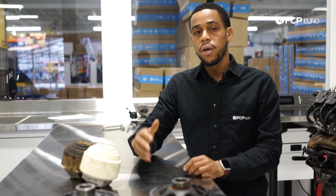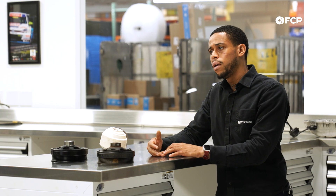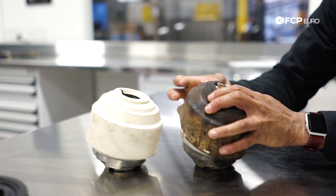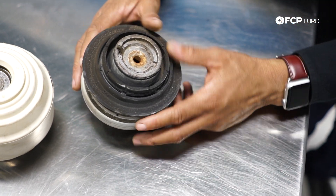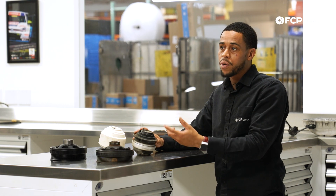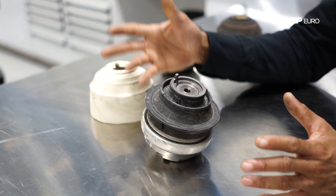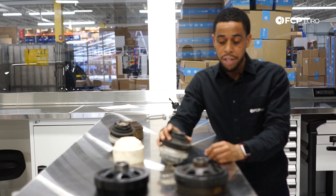And lastly, if you're noticing what feels like rough running at idle but all the engine's vitals seem okay and you have no codes, it could be your engine mounts. These don't last long on the W211 platform — it's not uncommon to go through an engine mount every 40,000 miles. If you remove the cover, most will be fully collapsed and you'll have oil everywhere since these are hydraulic-filled mounts. If you're looking for more resilient mounts, you can use an AMG mount like the one on the E55, or a Maybach mount featured in our Black Series kit — both are compatible with the W211 and are very stout.